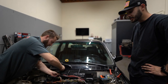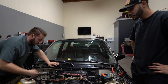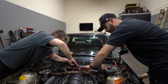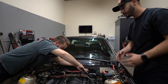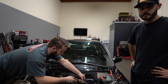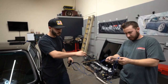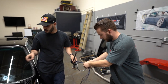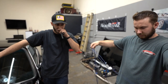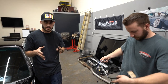BMW could have made it look better, but it's clean for an E36. We're not putting this motor in an E36, so the wire routing we're doing is probably as clean as you're going to get for an E30. Jeremiah had to separate some of the wires from the main harness because the way they bundled everything up is just so weird — he looks at this thing in disgust, he was about to throw it. According to him all he needs is three wires. This is going to be the harness adapter from Condor. All these blue wires are just crimpers — you have to crimp to some of the wires by the ECU inside the glove box, so you're going to have to run this through with the wires itself. That's going to give you your RPM, your fuel, your temp, all that good stuff for the cluster to work.